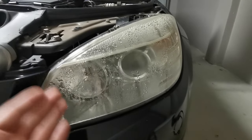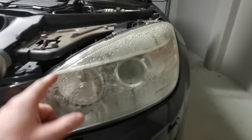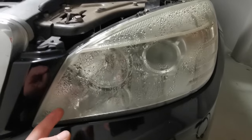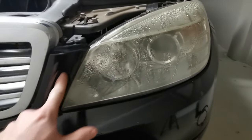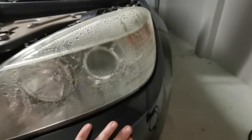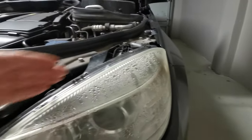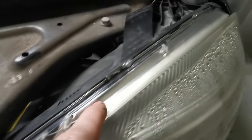This is something I've come across many many times over the years, especially doing body work, caused by damage. A cracked lens or split in the assembly anywhere around the top side where water can flow through, especially if you're getting an actual water level on the underside of it. If you're getting water coming in that is a very clear indication that you have some damage. I used to always assess where the impact damage was — check on the inner side of the housing, the lower side, the wing and upper part of the bumper, and along the top side where there is some cracking on this one.